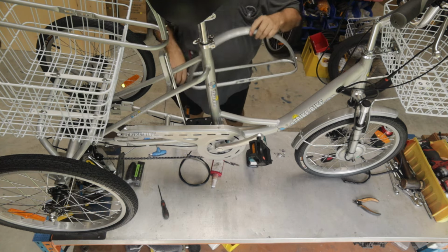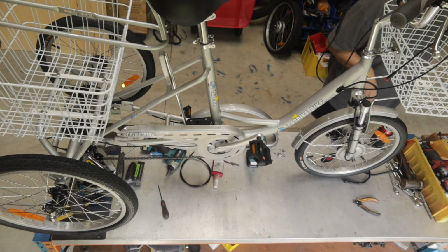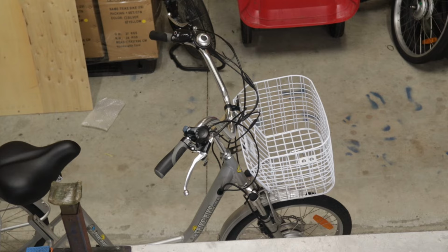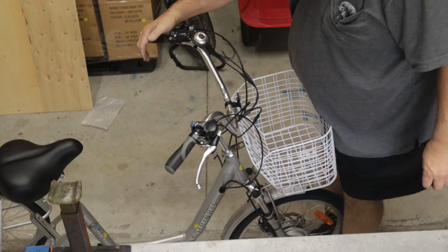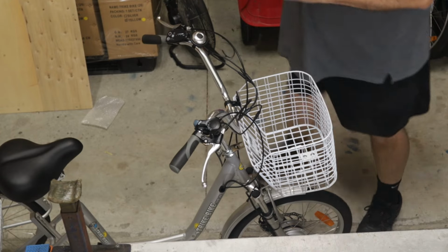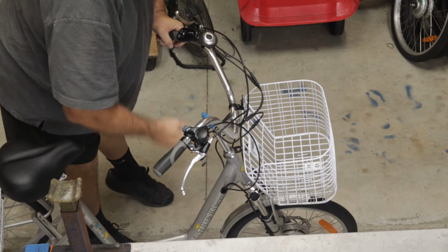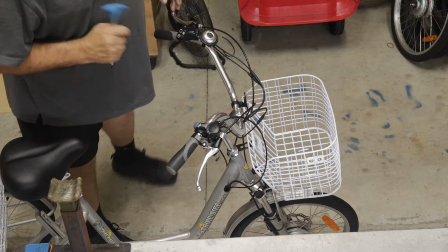Okay. These are now ready to go onto the bike. We're almost done. Just got to do the guards, and then we've... Okay, a couple of final adjustments. I'll line up the front wheel and hold it between my legs. The handlebars are off, so I'm just going to move them into the centre using an M6 Allen key wrench. I'm going to nip that up. So don't over tighten it, but you want it fairly firm.